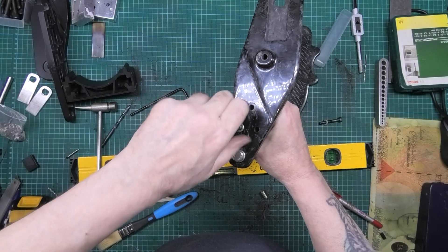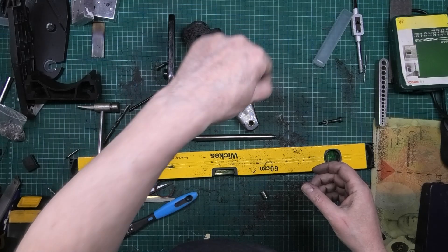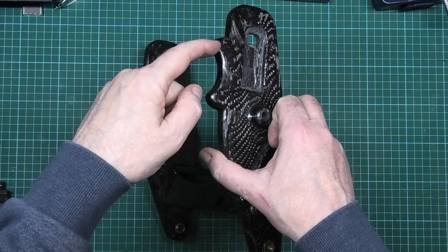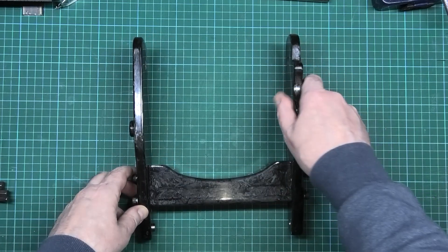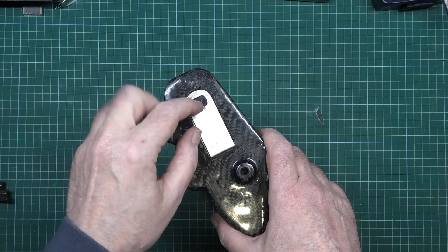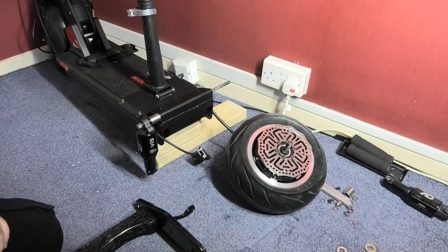I never make a mistake in my life! It'll be alright - I'll mix some resin off camera, get some chopped fiber, ram it down the holes, leave it 24 hours and jobs are good. And finally I've almost got it done - I've still got to drill the holes for the caliper which I'll do before I mount it. There's no rock on it at all. I've done the torque arms - that's the left one and that's the right one. I didn't want to use a dropout here; it might have been a bad idea and I might still add one.